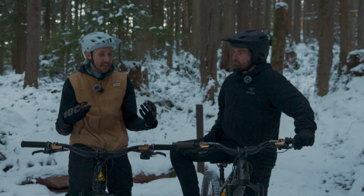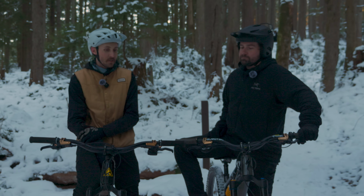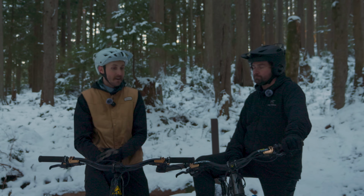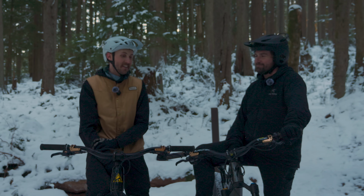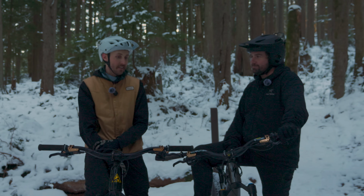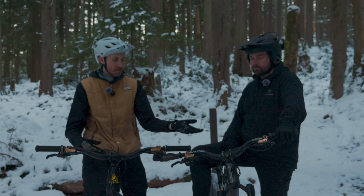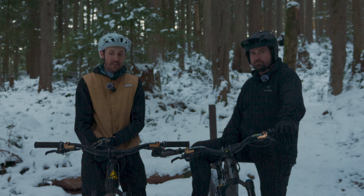You're probably gonna be bringing in more riders that previously didn't like the original DH-R Evos. I definitely think it's an option, but with the pad contact, pad activation dial, and the lever adjust, you can really dial these in. Obviously my first ride on them, I've got them set up fairly similar to yours, but it'll be fun to experiment with on these brakes.